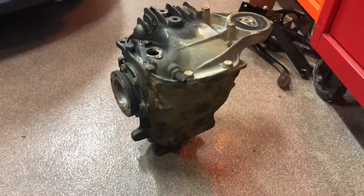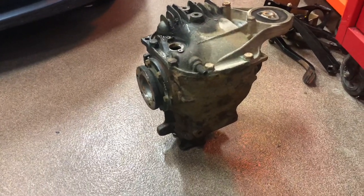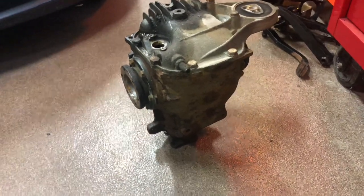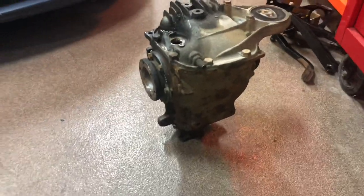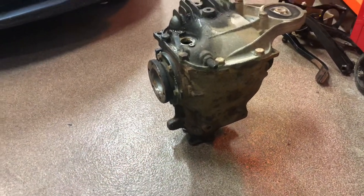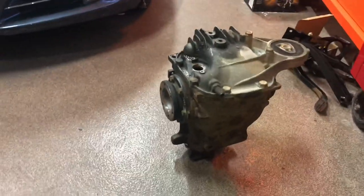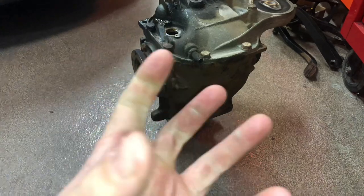I have kind of an oddball video for you guys. This is something I've actually never shown before, and that is the insides of an E30 188mm medium case limited slip diff. This is a 3.73 limited slip clutch type out of an '87 325iS. It is 188mm, so that means it's a medium case, which is the biggest diff you can get in an E30. I'm actually going to pull it apart because I need to send the ring and pinion and the actual clutch center to Spain.